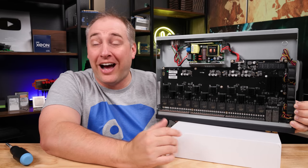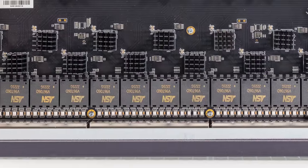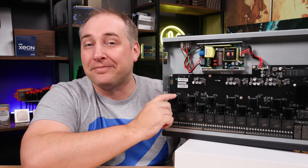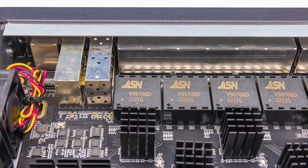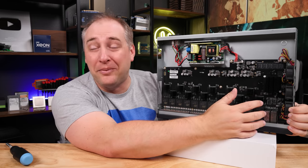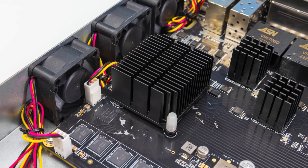On the main switchboard, you're gonna see a couple of really interesting features. First, we have a total of 12 little tiny heat sinks. With 48 2.5-gig Ethernet ports and 12 heat sinks, each little switch chip has a total of 10 gigabits — four by 2.5 — of bandwidth to its ports, and another 10 gigabits of uplink bandwidth, for a total of 13 switch chips in this switch. You're also gonna see the SFP+ and SFP-28 10 and 25-gig Ethernet ports. There's thermal paste on the PCB around the main switch chip — we didn't do that, it just came that way — suggesting they're saving some money on manufacturing.